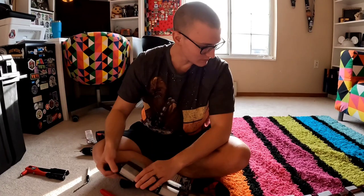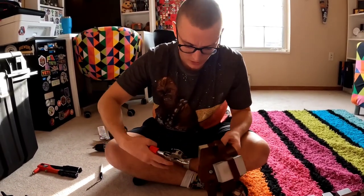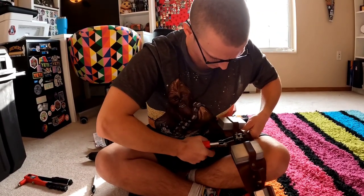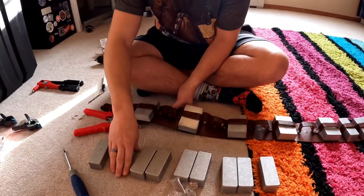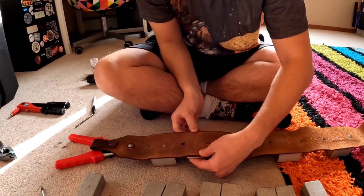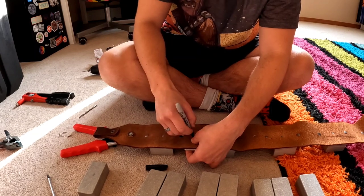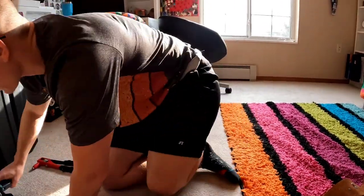All right, all the boxes are off. These are the new metal ones ready to be put on. There's already a hole in there, so I'm just going to make it bigger to fit my rivets. I'll use the punch to enlarge the hole, then flip it over, center it, take a sharpie and mark through the hole — that's where you're going to drill your new hole for the rivet to go through.